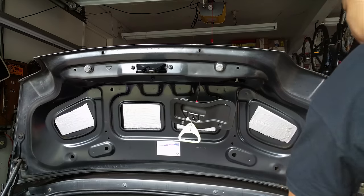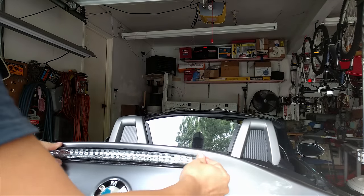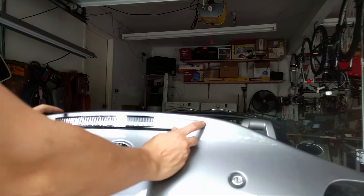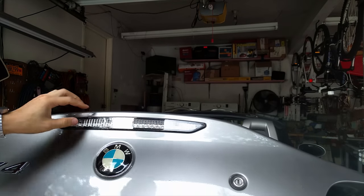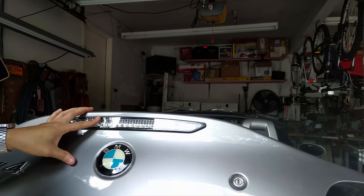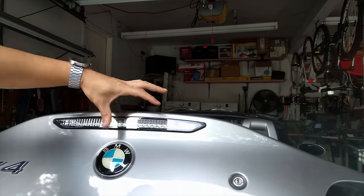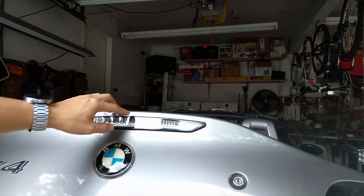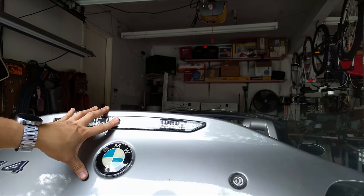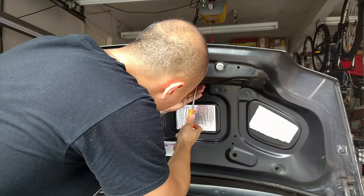Let's drop this new one in. You're going to have to slowly maneuver it into place — make sure you don't crack your new lens. When you get it in the right spot it should fit right in, not much pressure required. Now plug it in and tighten down the nuts, but you don't want to tighten the nuts too much. Over-tightening is really the reason why the old lens cracked — it causes a lot of stress at those three points over time and will crack your lens.